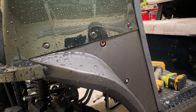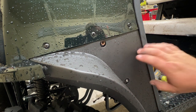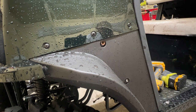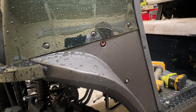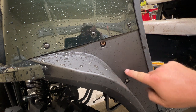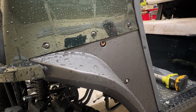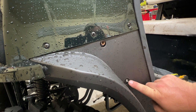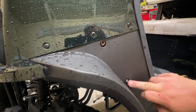So here we are, back on that same one again right there. If you've been watching anything on this cart long enough, we had a bolt break off in here. We had to weld a nut to it in order to get it out. One commenter said that he likes to drill these out and put nuts in from behind. And I may just do that with all four while we've got it this far — hopefully I can get this right here all the way drilled through.